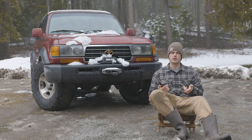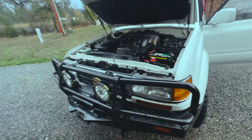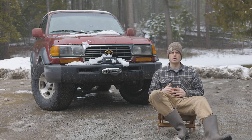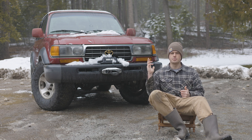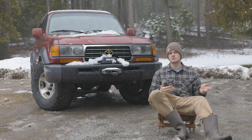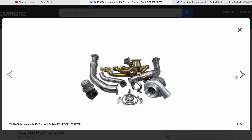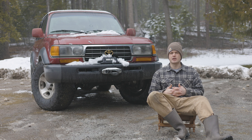I've gotten a lot of feedback on which engine to swap into this Land Cruiser. When my dad bought the white Land Cruiser that had the cylinder wall issue with a piston detonating, we now have a spare block — it would have to be overbored since that cylinder wall is scored. That's actually a good thing because I have a spare ECU and could use this engine in the 62 series when we do the ute chop. I know this engine is in good shape — good compression, runs well, I just replaced the head gasket. You can even do a CX Racing turbo kit for around $2,000, though there's a lot of DIY work involved with the intercooler piping and other components.